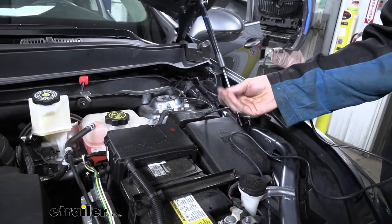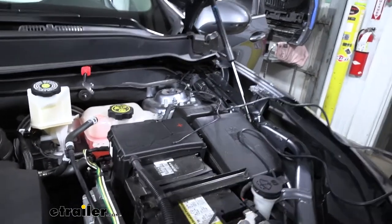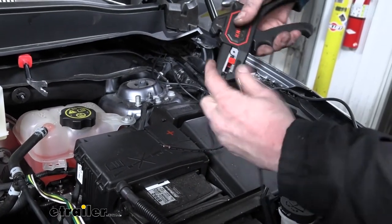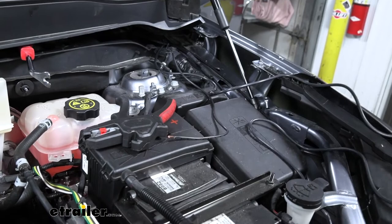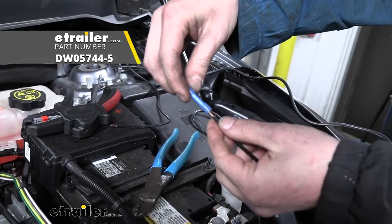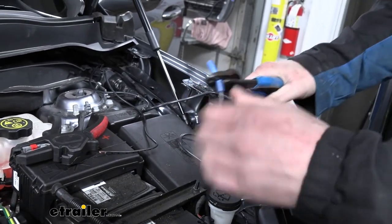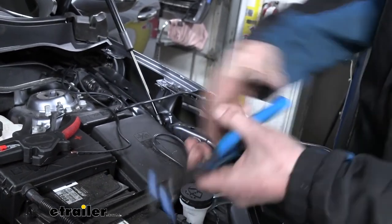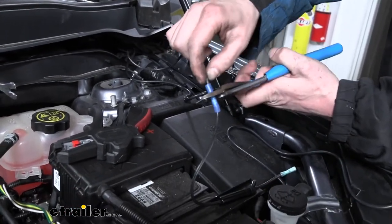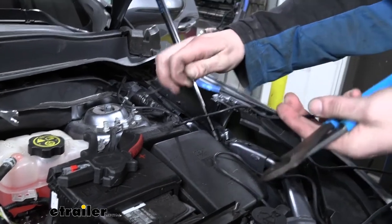We only need to pull until we can connect to our battery positive. Now we can go ahead and reconnect our fuse harness since we had cut that off. We'll grab our strippers and strip back both the end we passed through and the end we had cut off previously. We can then use a heat shrink butt connector — available here at eTrailer — to attach the two pieces back together. It'll slide over one of the stripped ends and we'll crimp each end on. Then over on the other end we reconnect it back to our 12-volt outlet. Since it's a heat shrink butt connector, we use a heat source — we're using a heat gun — to shrink down the ends and seal it up.